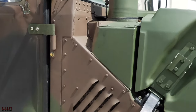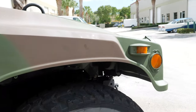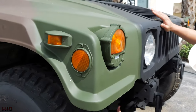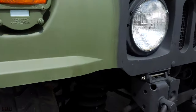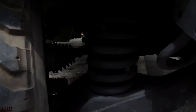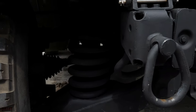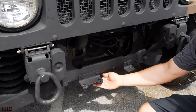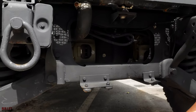The differences between an M998 and a 1097 are down here. You're going to have upgraded springs, shocks, protection for your portal axle, and then upgraded CV joints — so upgraded, heavier-duty axles. You also have undercarriage protection, which comes with most of these 2000 and up models.